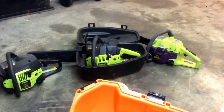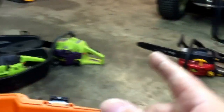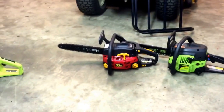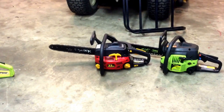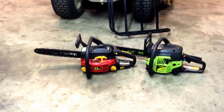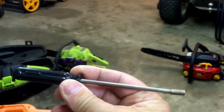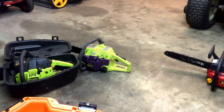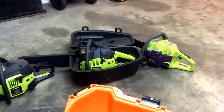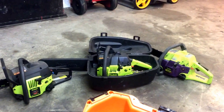Basically, over my many years of cutting trees, I've come to the realization that when you buy cheap Chinese junk, that's all you get is cheap Chinese junk. You're gonna have to work on them right out of the box. They have to comply to some pretty strict EPA regulations, so they crank these carburetor adjustments where they just barely crank up and run. First thing you got to do when you buy a new chainsaw is take your carburetor adjustment tool from Jack's Small Engines and open up both jets about a quarter turn, and the high speed maybe a little more, to get them to run right and have the power they're supposed to have. You can overdo it, but if you play around you'll find the sweet spot. You have to tinker with them.